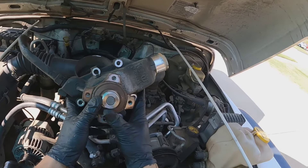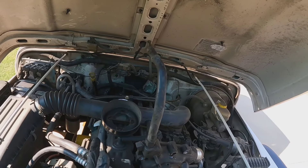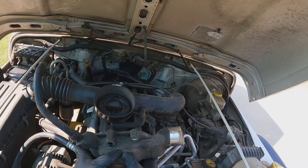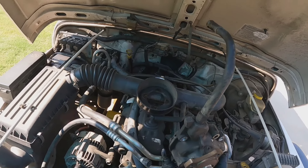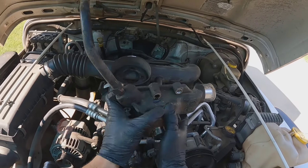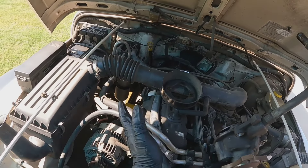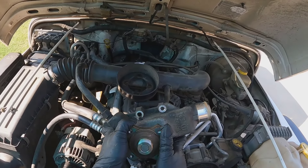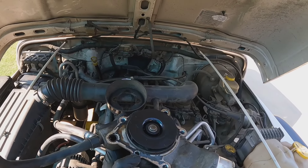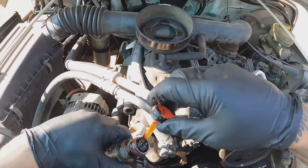Here's our old water pump. I'm not sure if I even mentioned why we're replacing this water pump — the whole reason is because this customer is experiencing overheating at idle, and it's not all the time, just every now and again on a really hot day. A while back I had diagnosed the fan clutch — it was engaging but it was really worn down. I suggested replacing it, and it worked for a long while without issues, but more recently there have been some more problems.